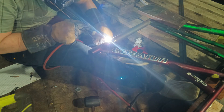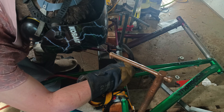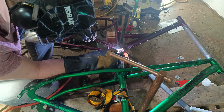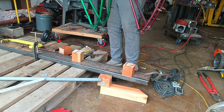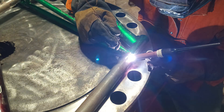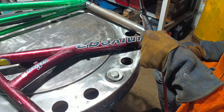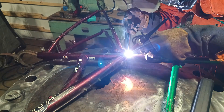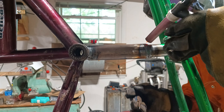Finally, I tacked the tube to the top frame. Since the top bike frame was slightly smaller than the bottom frame, the seat tubes did not align. To combat this issue, I had to force the seat tube extension forward. The seat tube extension was necessary to provide enough clearance for the rear brakes. I then prepared to finish completely welding the assembly together. I had extreme difficulty doing this because of my shaky hands. Be careful when welding threaded parts because excessive heat can cause damage. It was frustrating to have to re-grind the tungsten every time I dipped it into the puddle.